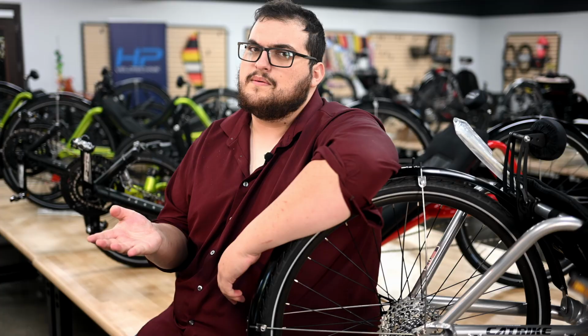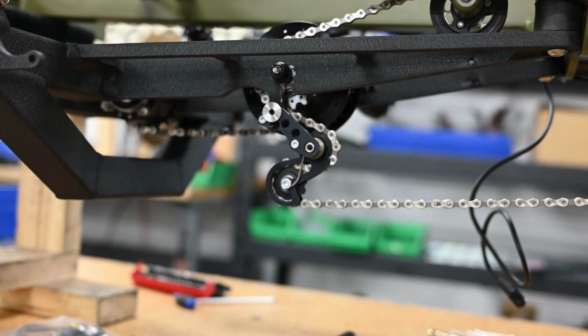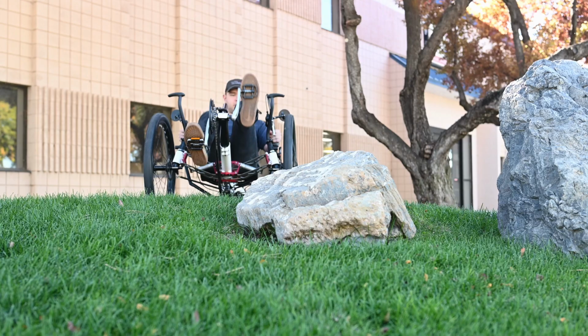One of the main advantages that a quad has is its ability to straddle objects. On a quad, the lowest ground clearance will be determined by the type of gearing, as derailleurs are usually hanging lower than the tensioner of a geared hub. For most, though, it won't matter too much, as the lowest points are positioned to move up with the wheels as it climbs over obstacles.